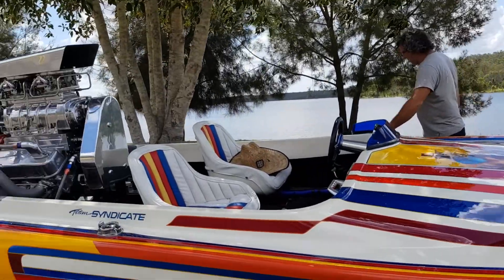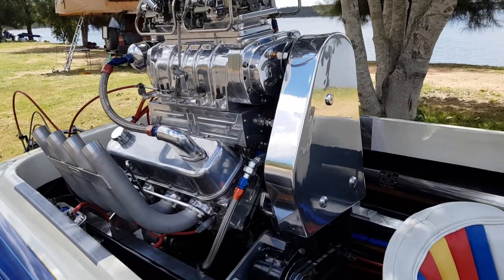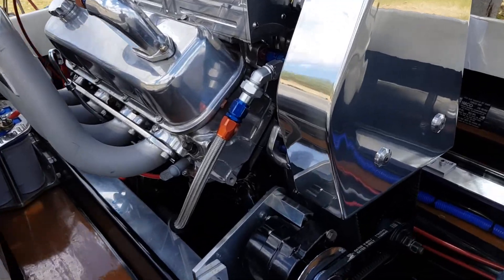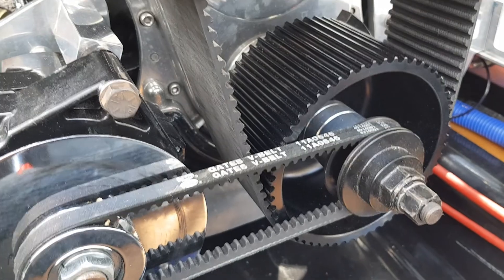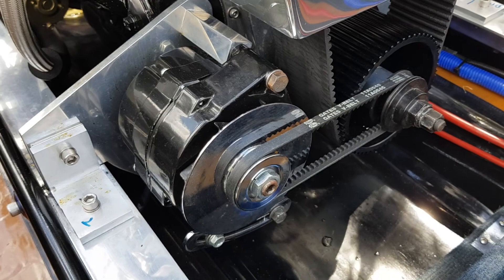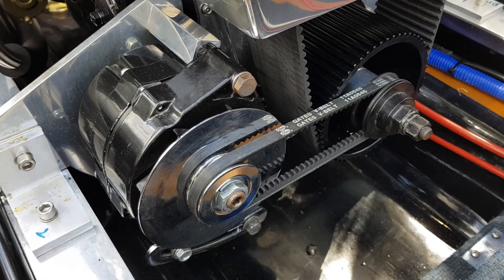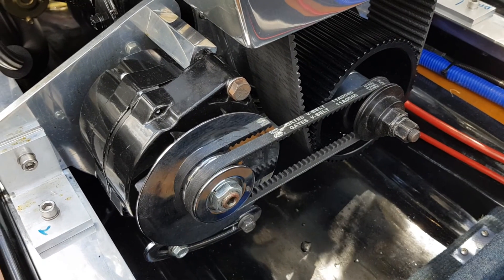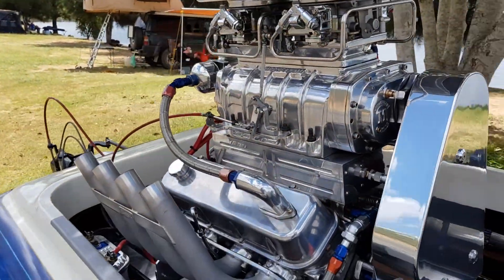Out of Paradise Dam for some more testing. We were tuning it last time and broke a supercharger belt, so we've changed from the old half-inch style to the 8mm round tooth. It was a bit of fun trying to get the length right and the pulley diameters right, but we must have fluked it. We also took advantage of the opportunity to change the ratio up a little bit, so we should get a little bit more boost. We're keen to try it out.